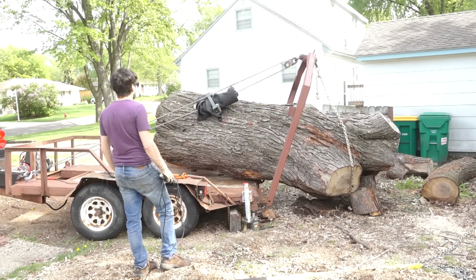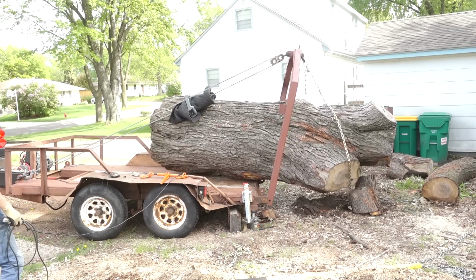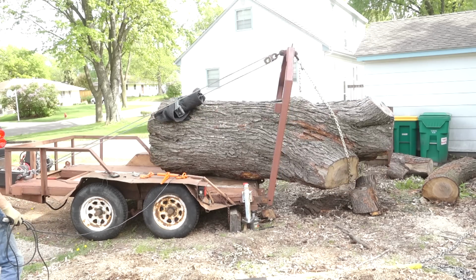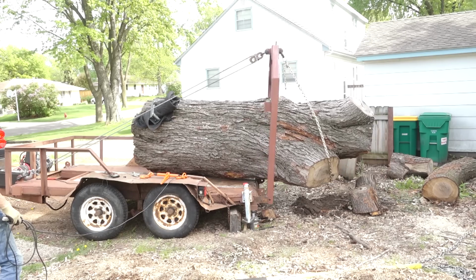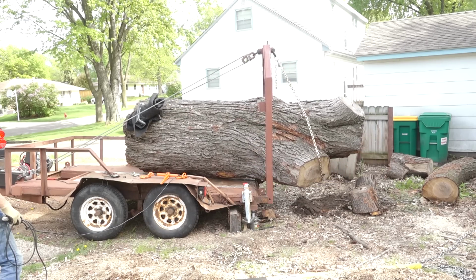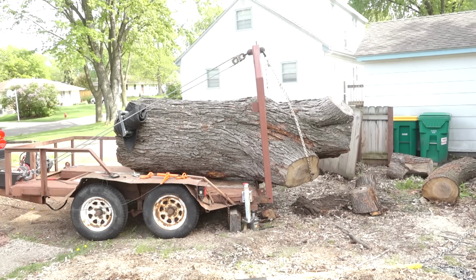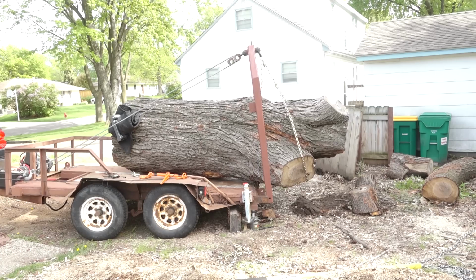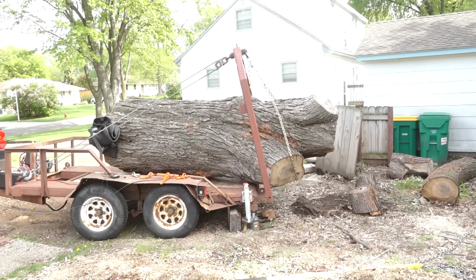It could also potentially entangle the cable, making the reach on the cable a little bit shorter, so it won't be able to whiplash out as far. And if the reach on a whiplashing cable is reduced enough so it just barely misses you, just in case you happen to be standing too close for whatever reason in that moment, those couple of feet can be a lifesaver. Now you can also get a synthetic cable for the winch as well.